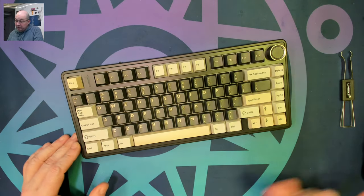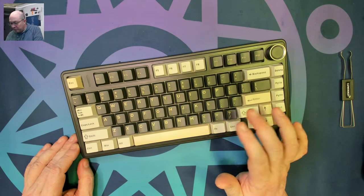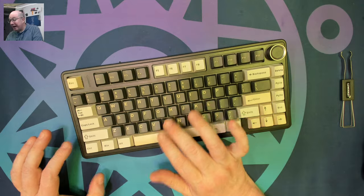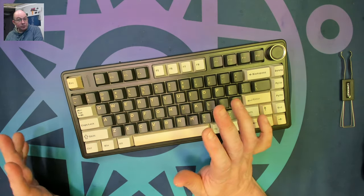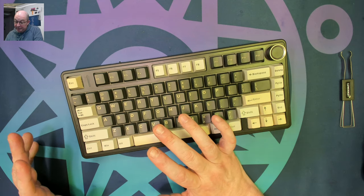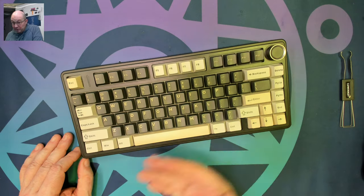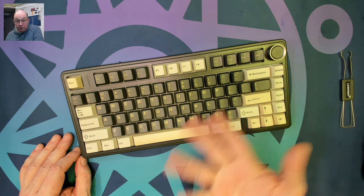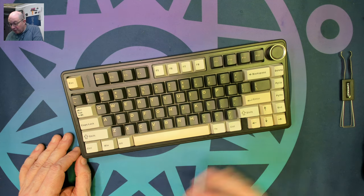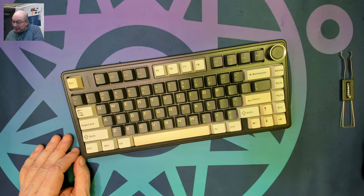I mean, this keyboard, like I said, for most people, this is going to be it. They're ready and good to go, but with a few different modifications, whether it's changing out the switches and or the keycaps, as well as changing the foams, either removing them, putting more in, changing what's at the bottom of it, removing the plate PCB foam, modifying the PET or the IXPE sheet layer, they're all going to allow this keyboard to sound completely different, but it has a good bass sound.